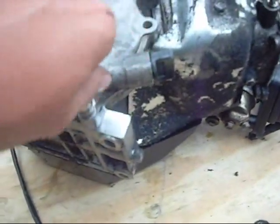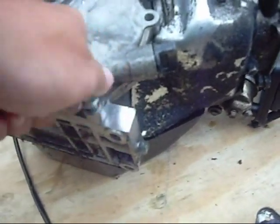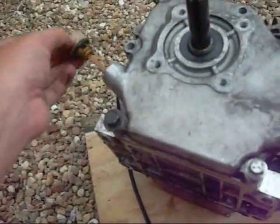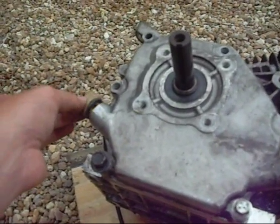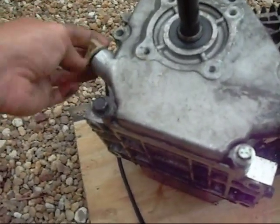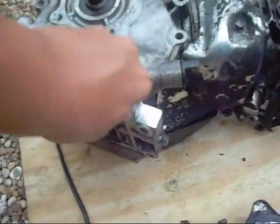He took that cover off and was experiencing some problems with overheating — and that'll do it. These two things are oil fillers. The one on this side has a dipstick. The way you check the oil, you don't screw it in — you just push it in lightly, then take it out and see how much there is. There's none in this engine, of course, which is how it met its demise. The previous owner ran it without any oil in it. Sixty dollars for a perfectly good bike without an engine — it's a pretty good price.